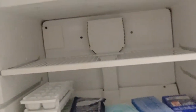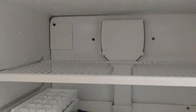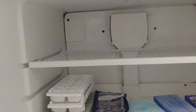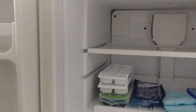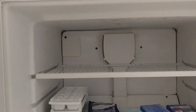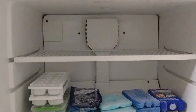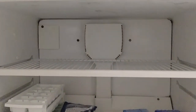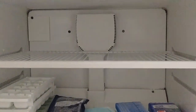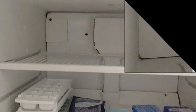Then obviously just dump the water down the sink and put everything back in the freezer, and you will no longer have water leaking from your fridge. It's really that simple — just leave the freezer door open overnight, let everything fall out and go down into those Tupperware containers. You do not need a new fridge, you just have to defrost the freezer. All right guys, have a good one, I'll see you in the next one.